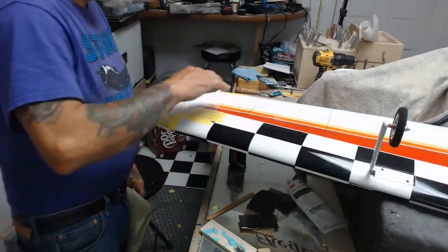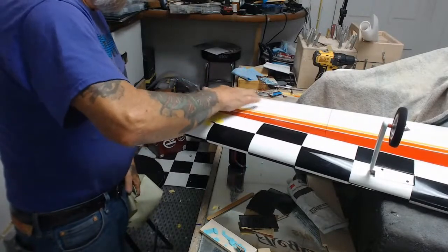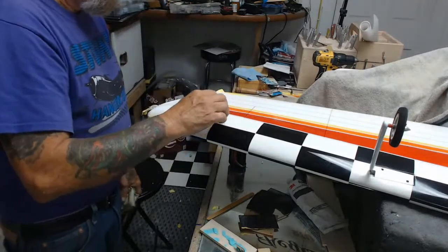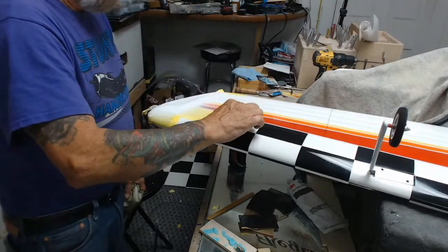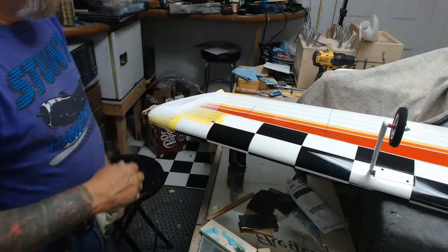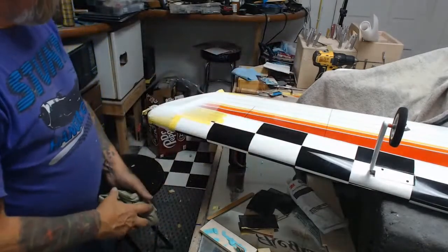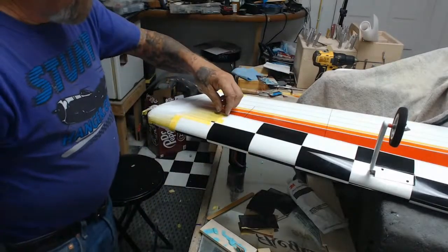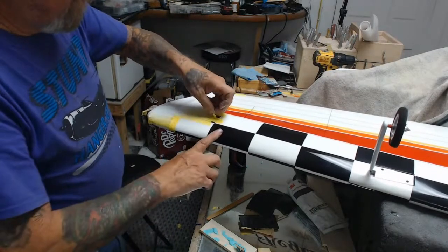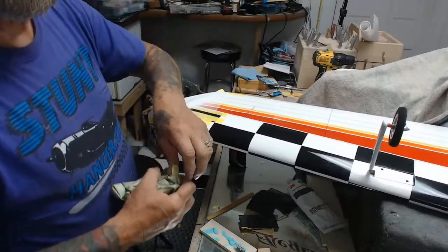See, the overspray sprayed up to the rib. The rib stopped it, the cap strip stopped it. But we're going to tape the red off and go all the way along it, and the orange off and go all the way around it. And then when I clear it, I'll clear it all the way back to here. Completely disappeared. Nothing different than the body shop.